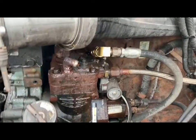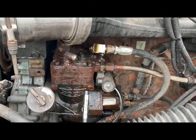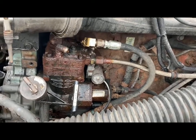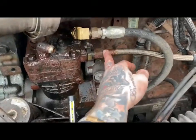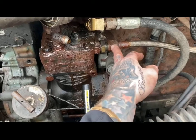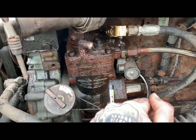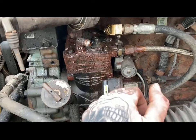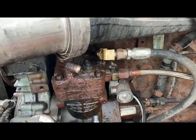As you can see, we went ahead and bypassed both lines. This is the proper way of doing it. However, there's a second method — you can build the air all the way up on the truck and take off the discharge line, which will release the unloader valve on the compressor. However, if it's not done correctly, it could still push air into the coolant jacket.